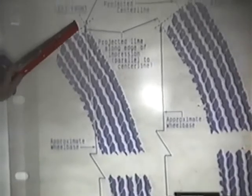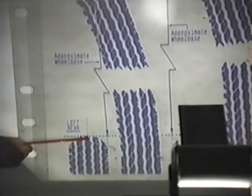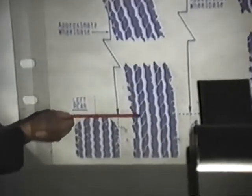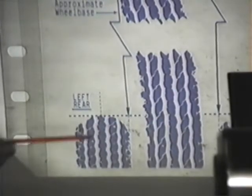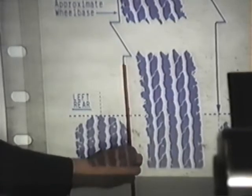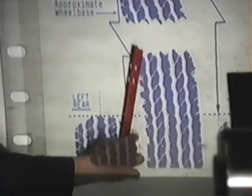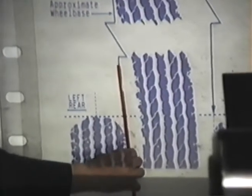The front tire has been turned and the shoulder, the edge, is usually not nice and square. It's usually rounded off. What I'll do is find a spot by looking very carefully at the ground where the tire has come to a complete stop and left an impression as far ahead as I can find. And I'll go at right angles to the direction of travel of the tire and I'll press it in the snow or the sand. Leave a line like that. Then I go right along the inside edge, right on the edge of the rib, the most outer edge of the tire, and press it right there. This is on the inside edge here, okay? On the inside of the rib, right on the edge of it. Press it in and I'll get the next crossing right there.